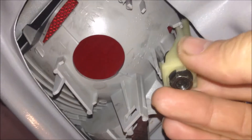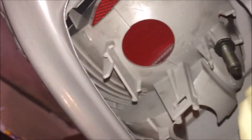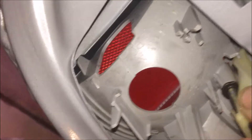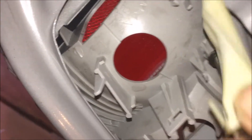Now we have released this, so you can remove the nut and the bracket together. You can see there's a slot over there — these brackets actually go into the slot like this when you install, so just remember the position. The tip part will be against the metal body and the higher part will be against the lamp body.